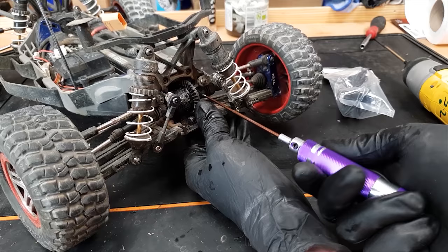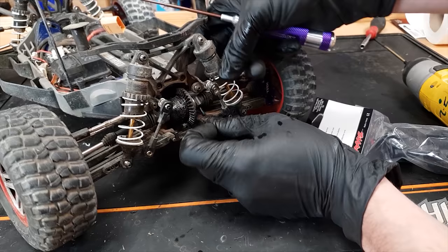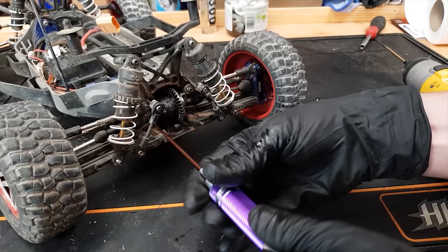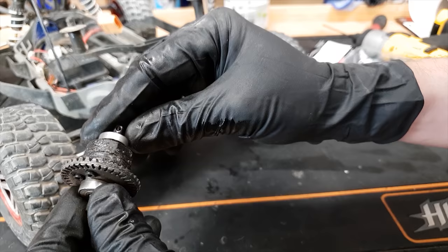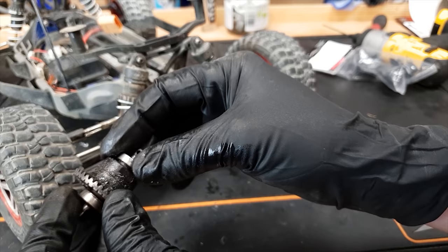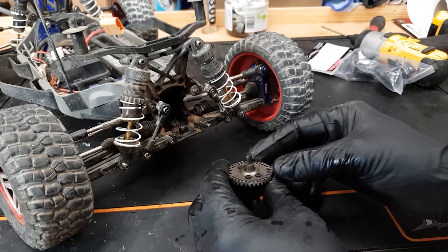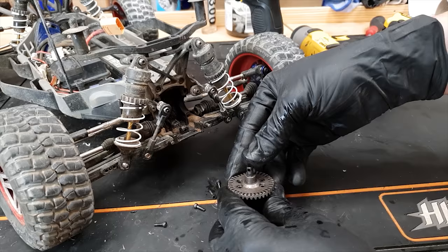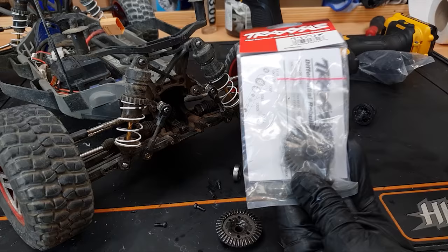This diff has been skipping around in here, so I'm thinking it's going to need more than just a diff case — it's probably going to need the ring gear as well, otherwise it'll give us more problems down the line. Looking at it though, it actually doesn't look bad at all — looks like we could run with it again. I don't know, it looks pretty perfect. I'm going to change it anyway — it's only four screws, so why not? I remember the X-Max didn't look too bad and I left it, and then it didn't work.